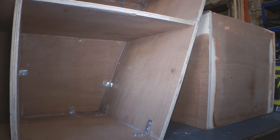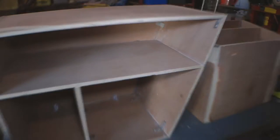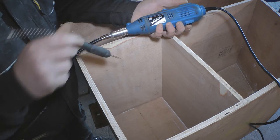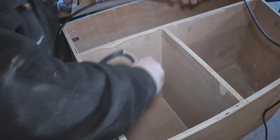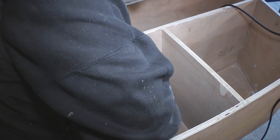I'll also mark and cut the 3-inch hole for the seatbelt to go through as well - it's easier whilst the fronts of the cupboards are off. I've got the hole marked exactly where I want it inside the cupboard. Rather than struggle with the hole saw inside the cupboard, I'm going to use the Silverline rotary tool with the flex drive to poke a pilot hole through and then I can use the hole saw from the back. If I flip this over I'll have a hole which I can use as a guide for the hole saw.